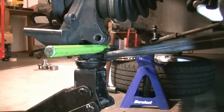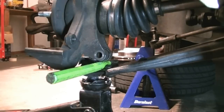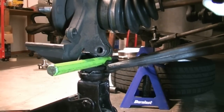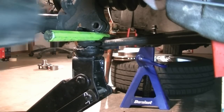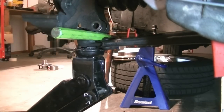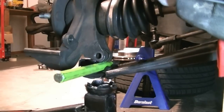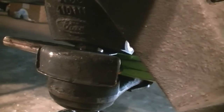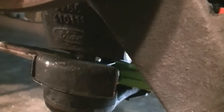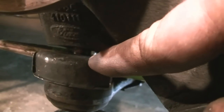We're gonna try that — nope, that didn't work, so we'll do it again. Make sure to hammer it all the way in this time. All right, it separated! Most of the time you hear a pop, but since I've soaked these with penetrating oil for the last couple of hours and there's not much corrosion on this newer car, there was no pop.